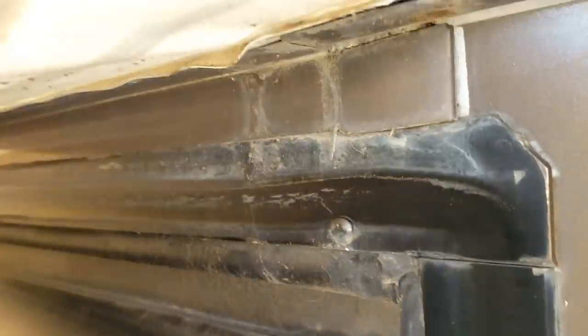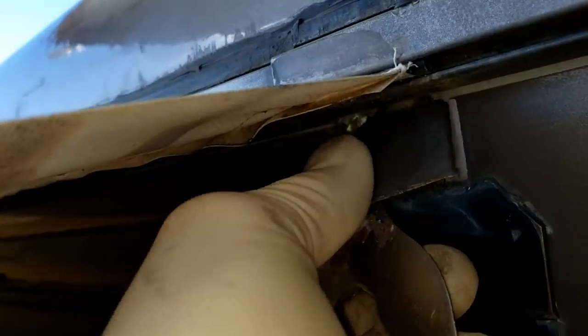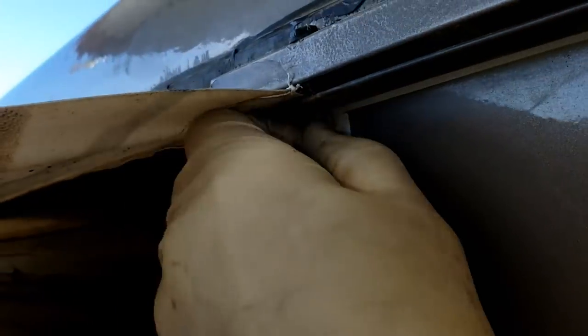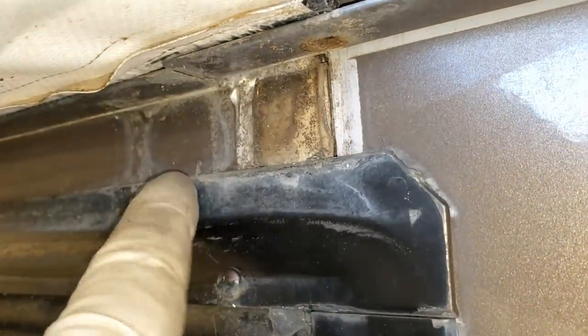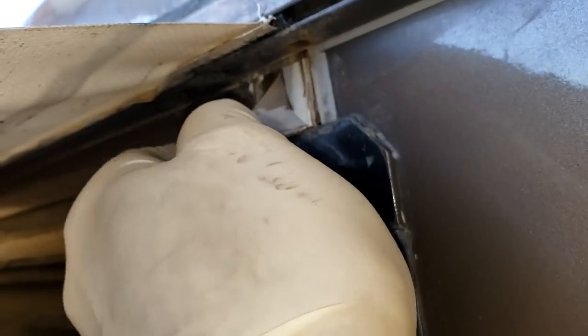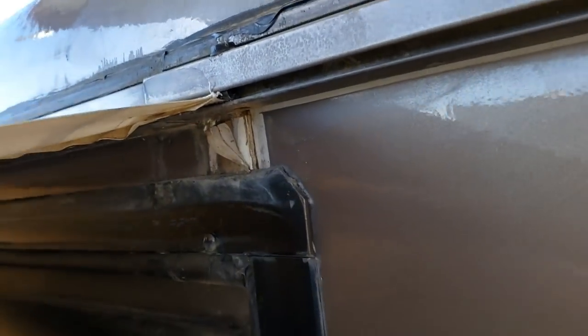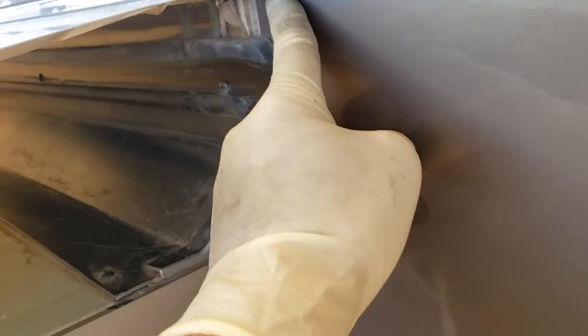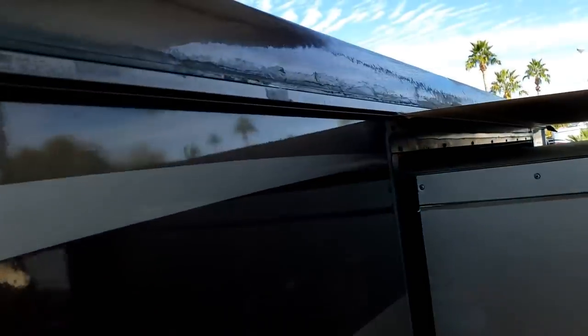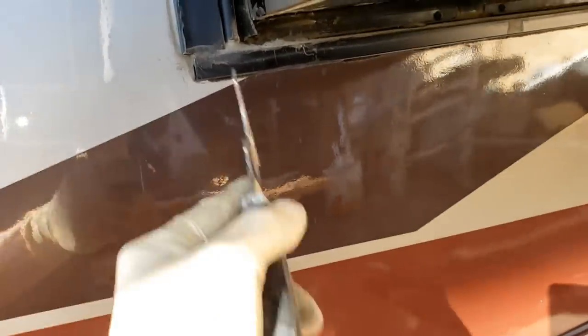So right here is that little piece of molding I was trying to point out from the ground — it's just usually glued on or double-sided taped on. That's double-sided tape — look at how effortless that was. So there's already a seam between this sidewall and that sidewall. The manufacturers learned that on this small piece of sidewall there's going to be flex driving down the road, so they just go ahead and make a seam as a relief cut so it doesn't crack — it gives a flex point. There's another one right above that slide-out, and it's usually common underneath the bedroom slides too.